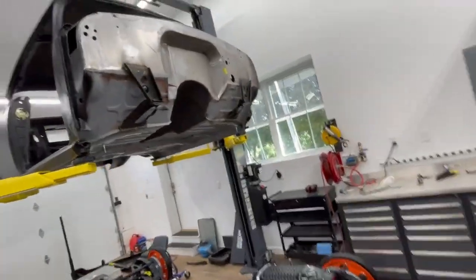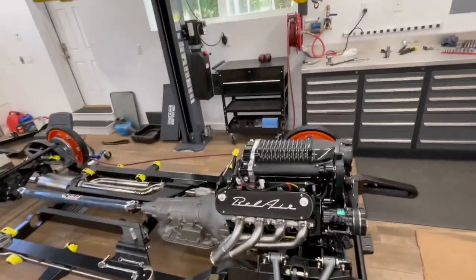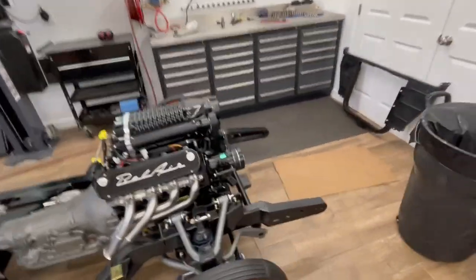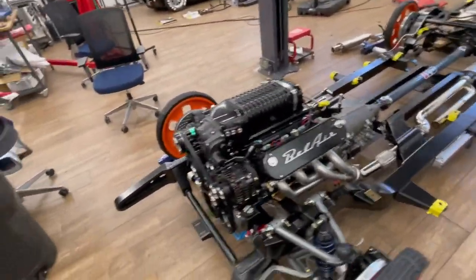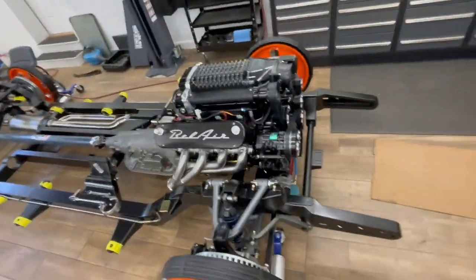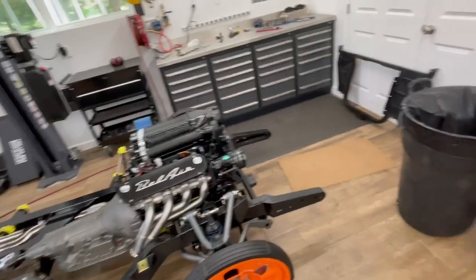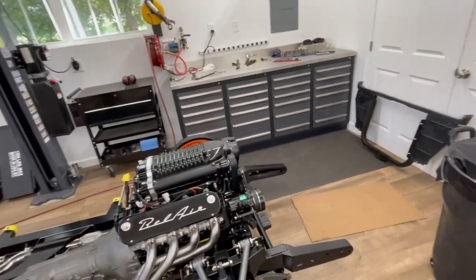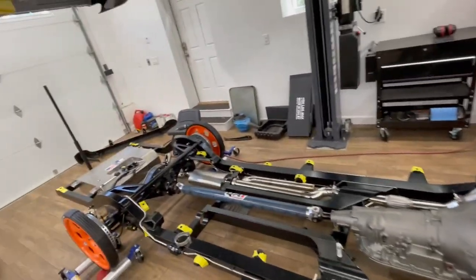On the body side, I cut and welded in the new chassis brackets - everything clears and fits perfectly. Once the exhaust goes in, the chassis is basically complete. I've got the steering column already, which goes in once the exhaust is on. Then I'll drop the body down and start rough assembly on the front end. C&R Racing built me a sweet cooling stack, but I'll need to sort an oil cooler, transmission cooler with fans, supercharger cooler, and power steering cooler. I need to figure out line routing, custom inner fenders versus stock, and where to mount the computers.